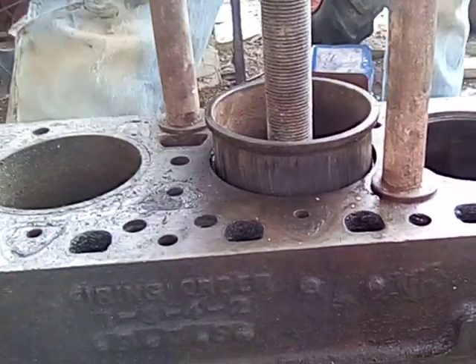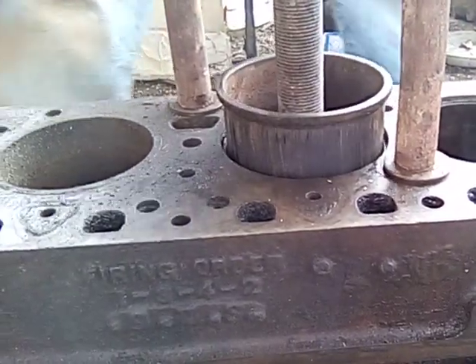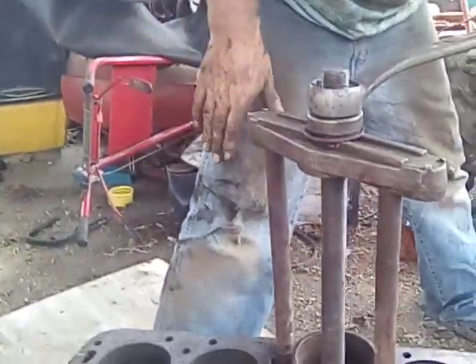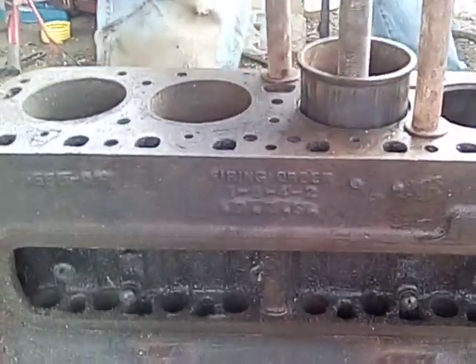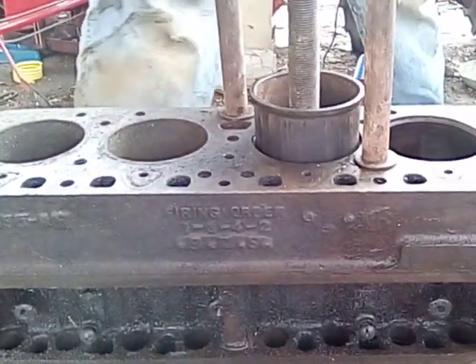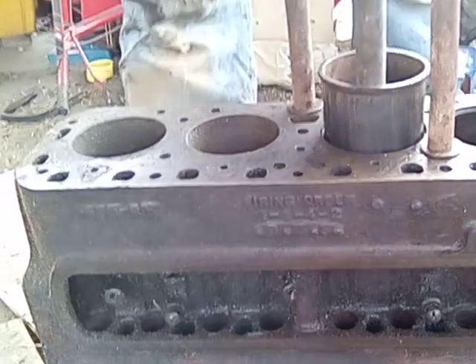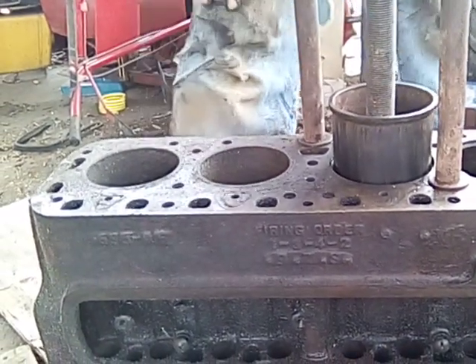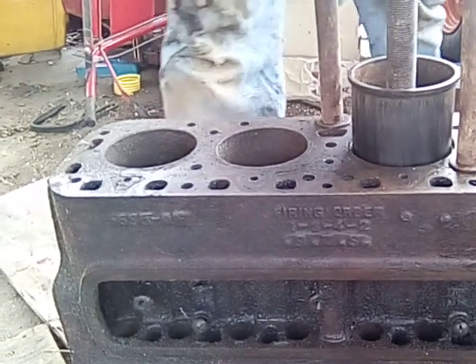That fine thread gives you gear ratio. If you use a coarse thread bolt it'd be faster, but it ain't got as much power. See, it's getting looser and looser all the time.